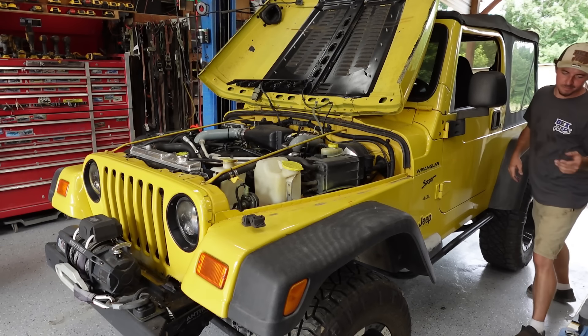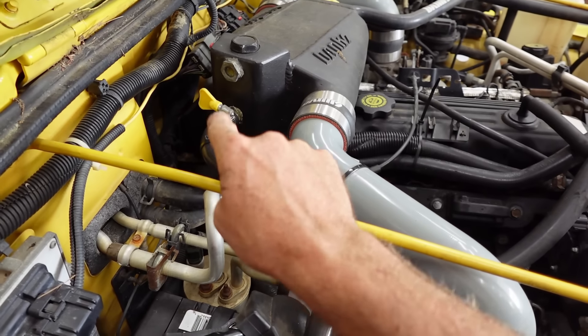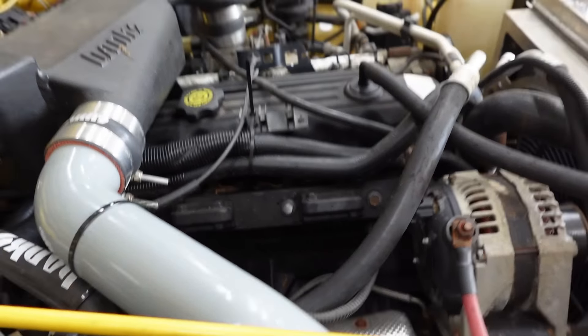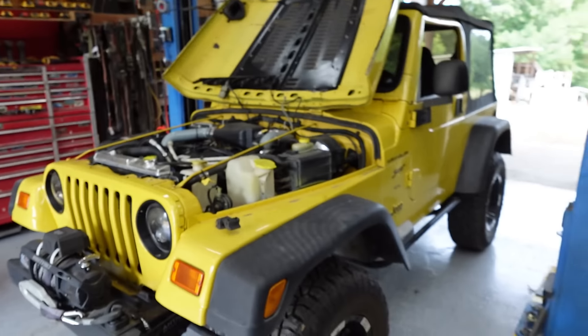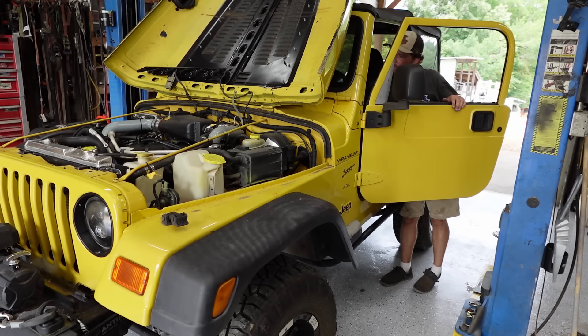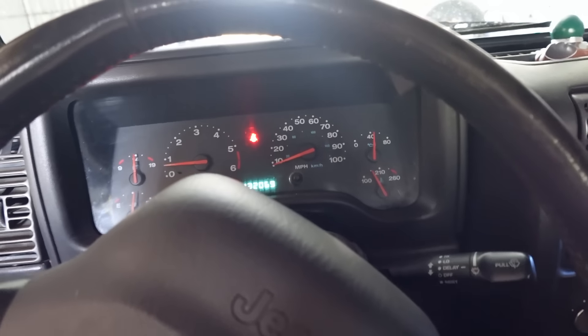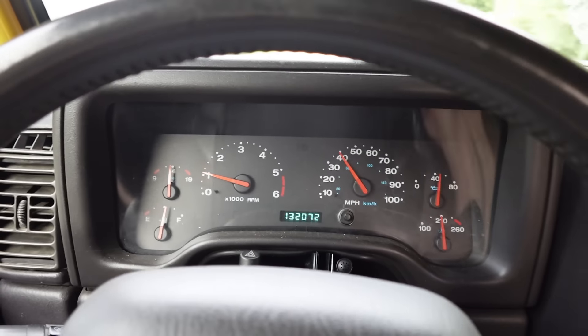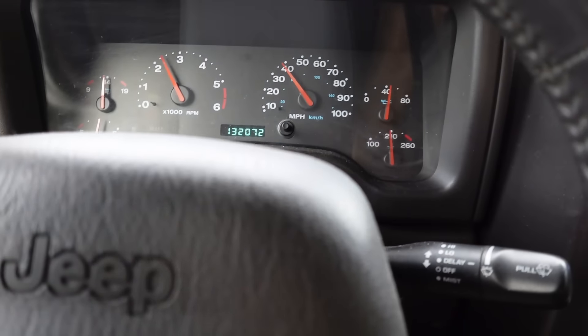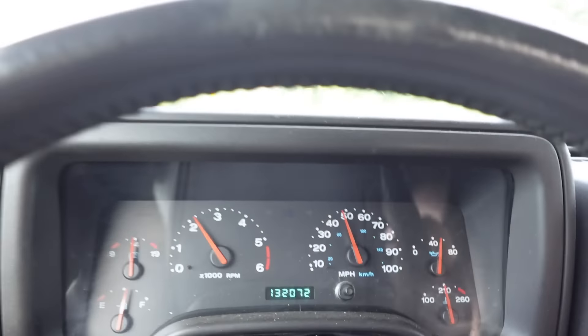I put number four's plug in number six and number six's plug in number four — swapped them out — and I've got a whole new coil pack. So far that's all I've changed and I haven't found anything wrong. If I remember right it runs good until you get some heat in the motor, so this could be electronic. I'm pretty sure there's a code for cylinder four misfire. I'll give it a test drive. Well, it's not fixed. I'm starting to think fuel pressure — I'm going to shove it into third and do about 40. It's just like an all-around miss now, not a consistent one.